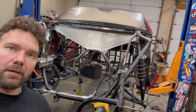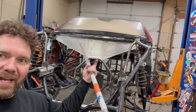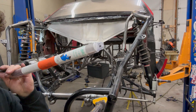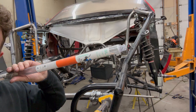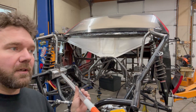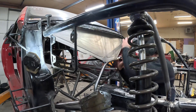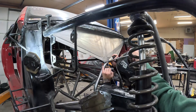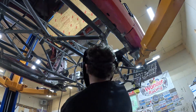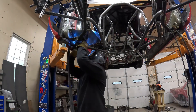We have a firewall somewhat in — the bottom portion to the tube requires a little different strategy, because this sheet metal is super thin and the tube is thick. You use what's called silicon bronze — it's kind of like brazing. It almost just flows in at a much lower amperage. In order to fit the next piece of the firewall I actually have to do a little bit of the floor first, so here I am welding in a piece of the floor while my dad gets it all cleaned up ready for the next piece.